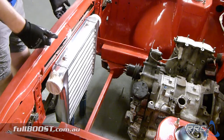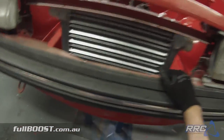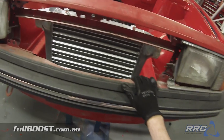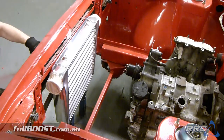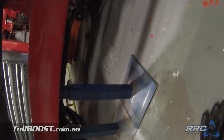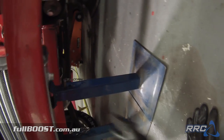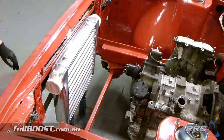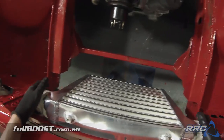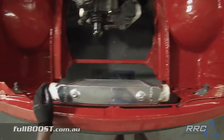Roughly there is where we want the intercooler to sit — we could drop it a little and recess it, there's a lot of space in the front of the grille. What we want to be mindful of is not having anything too low — if this car does an aggressive wheelstand and hits the front springs hard, whatever is the lowest point here takes the full brunt of it. The chassis cross-member and low points are down here, so keeping the intercooler and radiator above those points means they won't contact the ground.